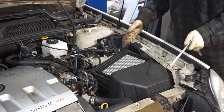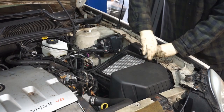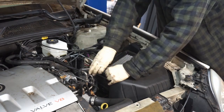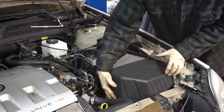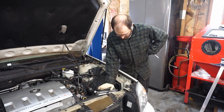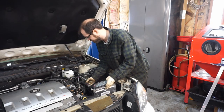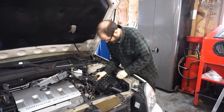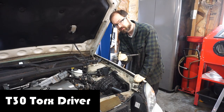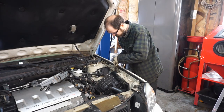Next step is the air box here — it's two pieces. There are three 8mm bolts that hold this piece together. This doesn't have to be done, it just makes it a lot easier to get to a lot of things. Got that top cover off. Here's the computer, the PCM, and we want to just move this out of the way. I'm just going to take this and free it from there and sit it up on top of the engine gingerly. You need a T30 Torx driver — there's a bolt down in here, a bolt here, and a bolt here that are all T30 Torx.